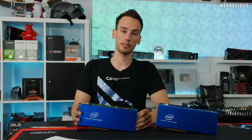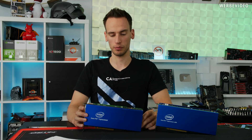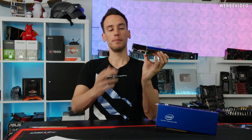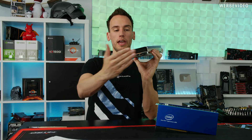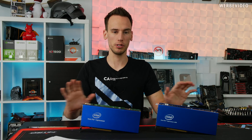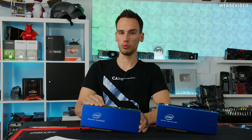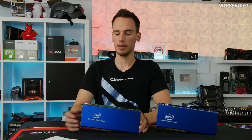Today we'll take them apart and take a close look at them to improve the cooling, because a company from Austria contacted me - they are using these for scientific calculations and had some temperature issues. As you can see, they don't have any active cooling; they have passive cooling with a heat sink inside designed to be built inside a server rack where air is pushed through. It's not meant for a normal consumer system. We'll mount some water cooling gear on those, along with a dual socket CPU board, mount everything inside a case, and try to improve the cooling.